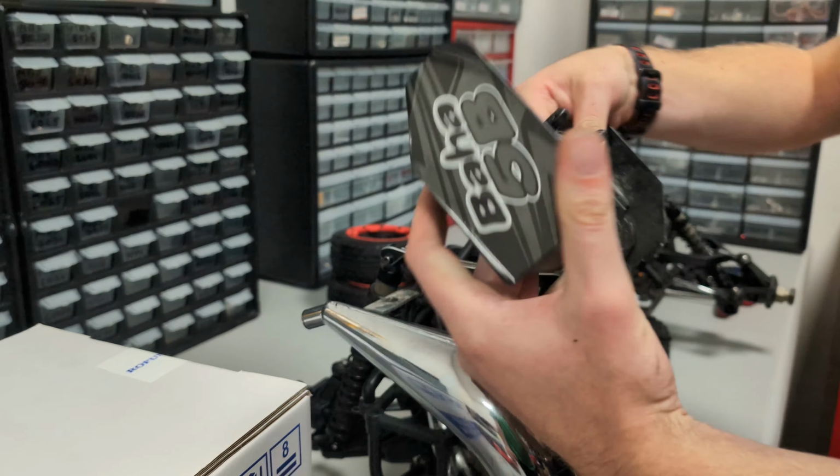And these ones were actually coming loose, so it's good that we're doing this right now because these were about to come out. There's this plastic part right here that basically ties into the brakes, and some Bajas have this, some don't, but this bolt is a little tricky to get to, so I just use an L wrench and pliers for this one. Okay, and then so I don't damage the brakes, I'm gonna leave this loose until the very end. This will be the last bolt I take out.